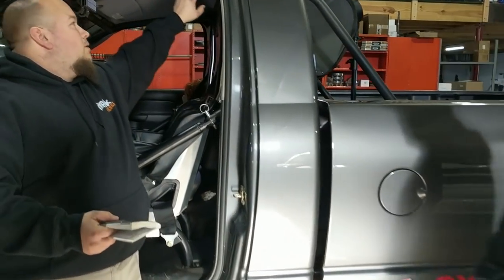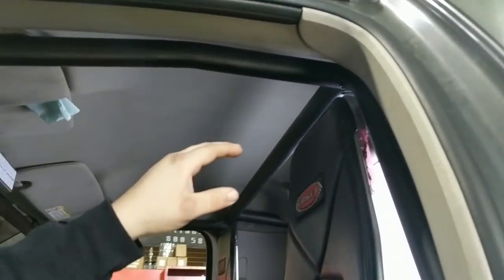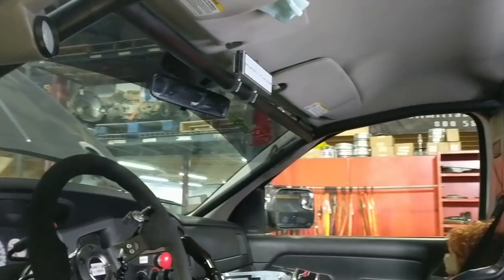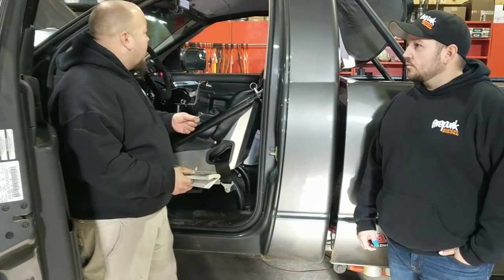What we run into on a truck like this where it had a previous roll bar is that it's already fully welded in place and you can't get to some of the really tight areas up in the roof — we're pretty much against the headliner here. One thing that helps in a situation like that is NHRA does make an allowance: if you can't complete a weld, you can leave as much as 25% of the weld out if you gusset each side of the pipe. That's something that'll help guys in a tight spot.